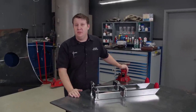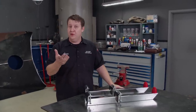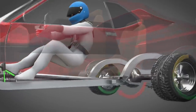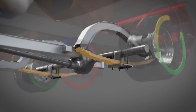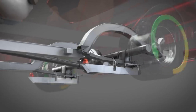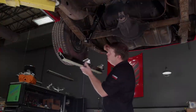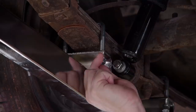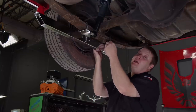If you're a fan of 70s-era muscle, you've probably seen a set of these — traction bars, slapper bars, torque bars, whatever you want to call them. These serve a bigger purpose than just looking cool. They're designed to limit axle wrap: when you stomp on the gas pedal, the engine applies torque through the rear end, causing the differential to rotate in the opposite direction of the wheels. This causes the leaf spring to flex upward in the front and downward in the rear — if too excessive, it causes wheel hop and loss of traction. By installing traction bars, you limit the amount of flex during heavy acceleration. To install a set of Lakewood traction bars, you've got a couple of U-bolts — cinch them down and you're pretty much ready for a night on the town. When tightening, make sure you don't tighten one side too much, because you'll actually pull it off to one side.